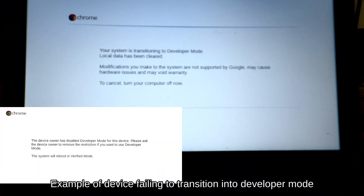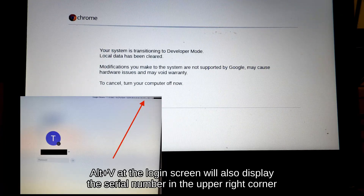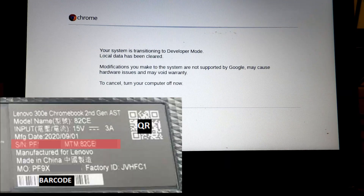Step 7: After the Chromebook reboots, an OS verification warning screen will pop up. Press CTRL+D quickly to launch ChromeOS. If it says developer mode has been disabled, check to see if guest mode is available and stay in guest mode for about 2-3 minutes before trying to get into developer mode again. If it still says developer mode is disabled or you cannot get into guest mode, email the serial number to the controlling entity so they can release it from Enterprise Enrollment. Note that the serial number goes with the plastic panel covering the motherboard, so if the serial number is simply wrong, you will have to flash the BIOS using hardware to continue. A link is in the description.